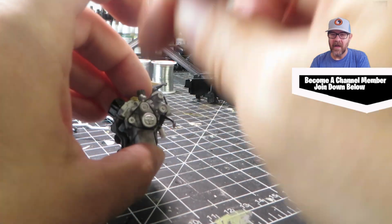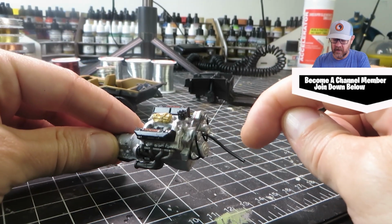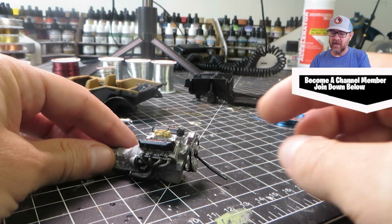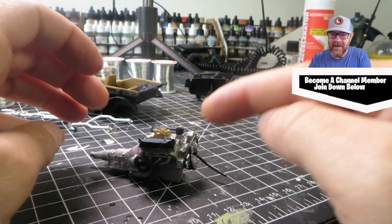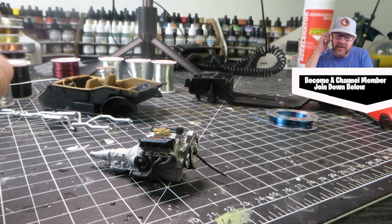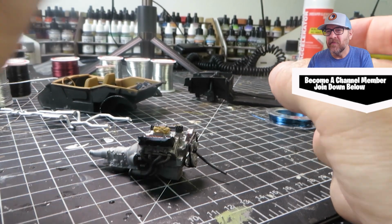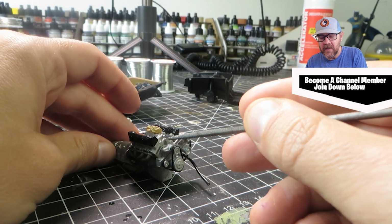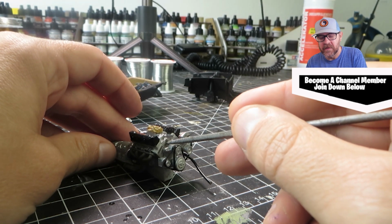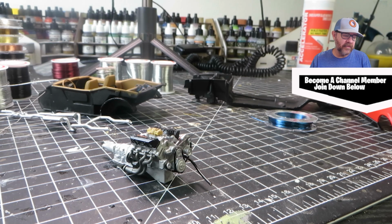Now, with that said, I don't have an upper radiator hose. They've been sold out in the size. Obviously, I could use the same as the lower radiator hose, but that upper radiator hose is usually a little bigger, and I don't have the size for it. I can find the hose in some places, but I can't find the fittings. The hose needs to attach here on this intake. There's kind of like a little thermostat housing here, so it needs to attach here, and I want some kind of fitting to go there to clean that up. The fittings are sold out everywhere. I can find the hose.